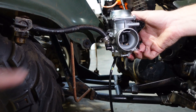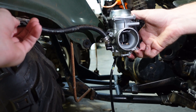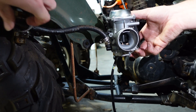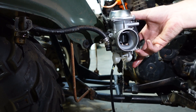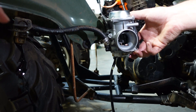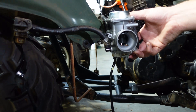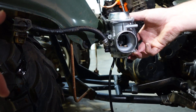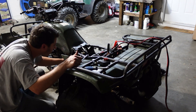We think we made a discovery. We have the gas tank and fuel line connected to the carburetor and currently we're set to Off. If you turn it to On and let the float down, no fuel comes out. But if you go to Reserve — straight down on the fuel petcock — and let go of the float, it comes out. We've had the fuel turned to On the entire time, but there apparently isn't enough fuel in the main tank. There's always like half a gallon reserved for when you switch to Reserve. That's what's going on here, so we're putting it back together on Reserve.